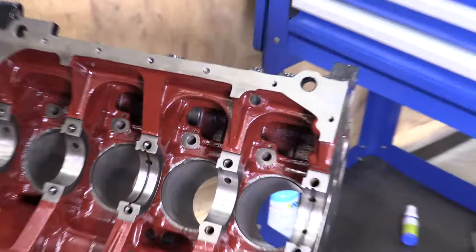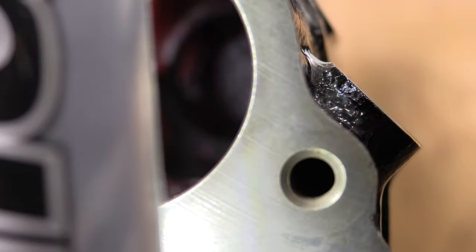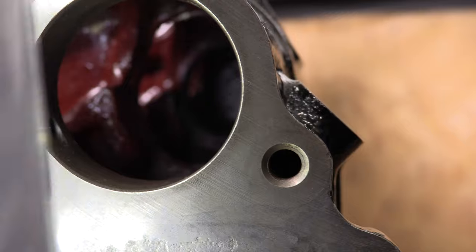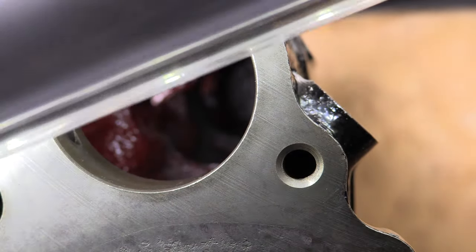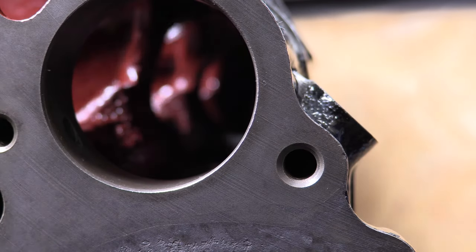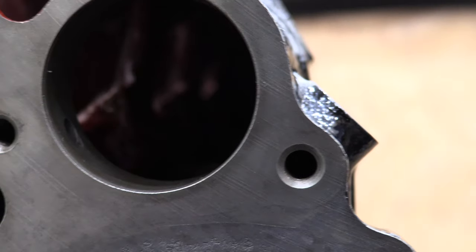I'm using the same factory bearing and blocking off the oil supply holes on the right shaft by rotating their orientation 180 degrees in the bore. So look in there and verify the orientation of your bearings so that they're facing precisely where you need them for whatever configuration your build requires.